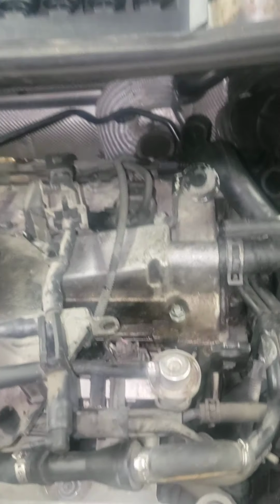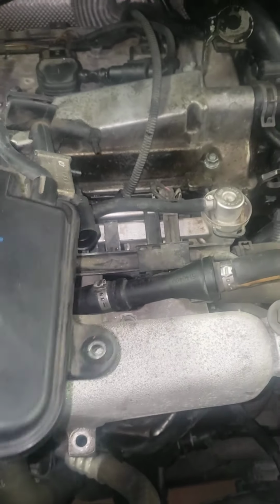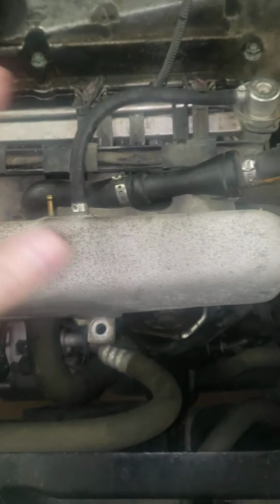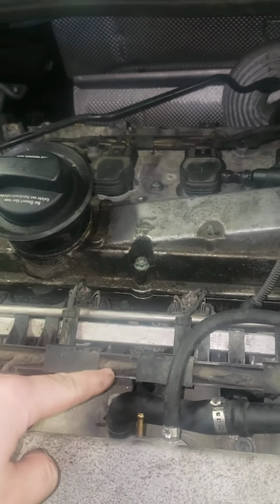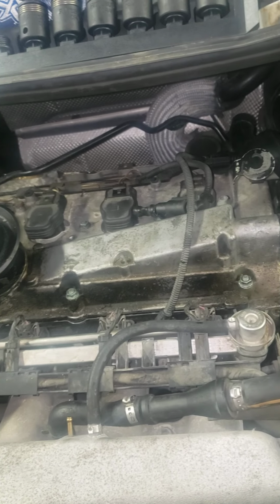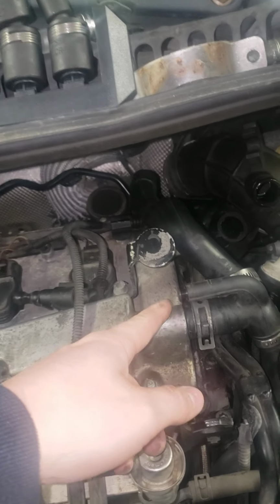So then once you're done with all that, go down with the turbo, take it off, put a plug. So just unbolt this off the top of the engine. Discard it. Now on mine, it was pre-owned, so it didn't have any of the hosing that was already supposed to be here from this to this. Sorry, I'm not holding up the camera right. I haven't never done this before. So all that vacuum hosing can go. Just block off there.